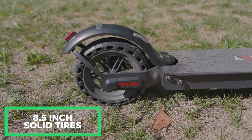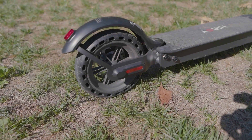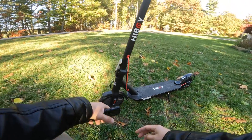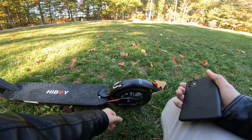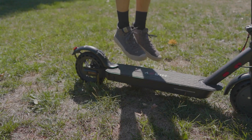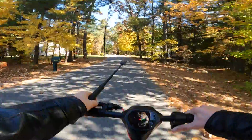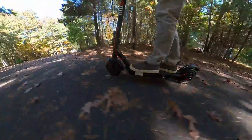The tires on this scooter are 8.5 inch solid tires, so you don't have to worry about punctures, but solid tires don't have the same kind of shock absorption as pneumatic tires do. This does technically have a swing arm — the rear wheel is on a pivoting swing arm. Slow motion shots show it does compress when I jump on it full force, but it really only compresses under that kind of impact. There's absolutely no dampening or shock absorption of any kind during actual riding. It's just a gimmick.